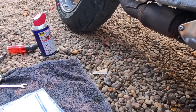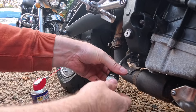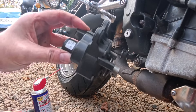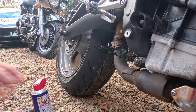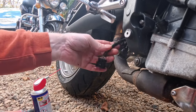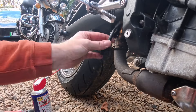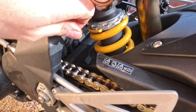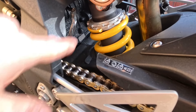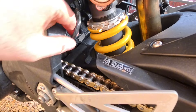There it is — nice neat little unit. This replaces the servo motor. You can see the wiring loom coming off the bike — this plugs into there and stops your engine management light coming on when you've replaced this servo. What I want to do is this loom is hanging down right in the middle of all the muck and rubbish off the road, so I want to try and reposition it further up the bike and get it looking a bit neater.